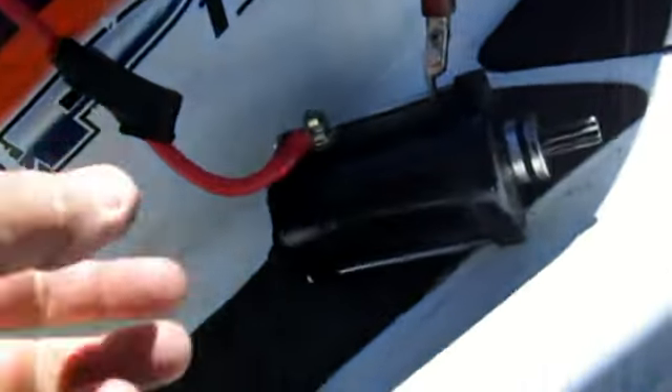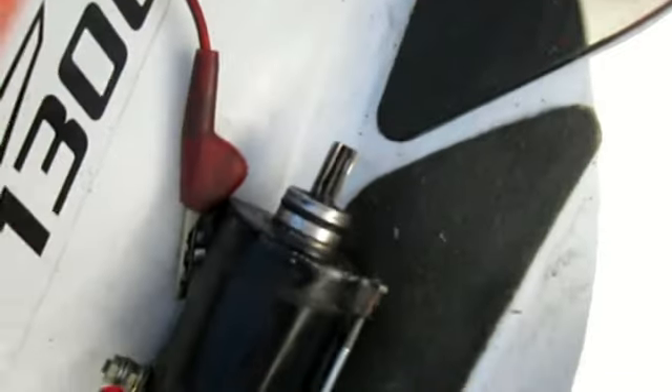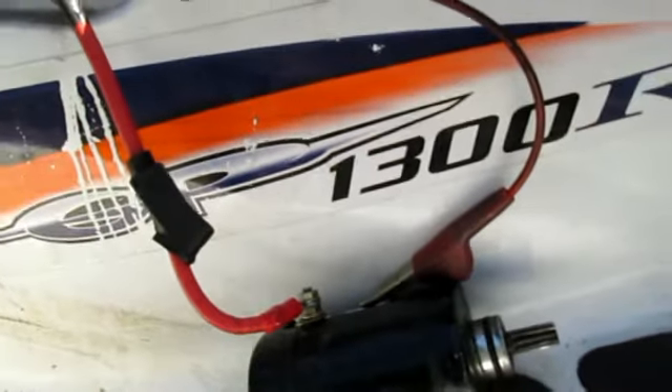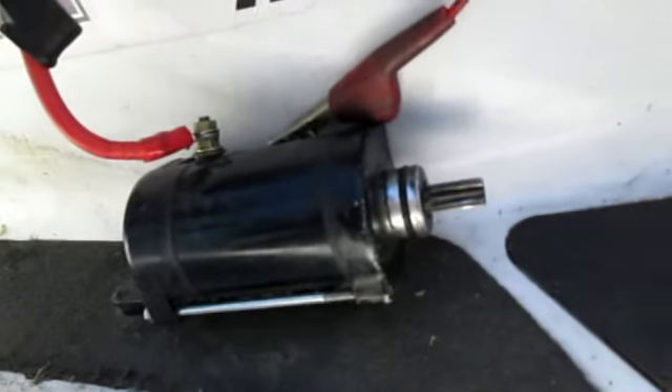Here is your starter — as you can see, it's still in, and here's how it bolts in. I have a test starter hooked up. That's your positive cable. I just check power and ground — it's good to use as a test starter to check powers and grounds because you can see it moving, and I can show people that it works. I'm going to be pulling your starter now. But it looks like you have a bad starter at this point.